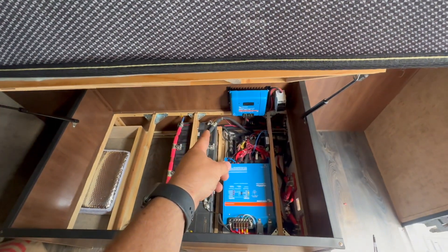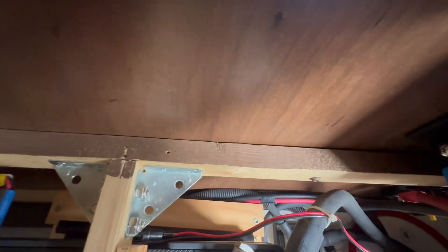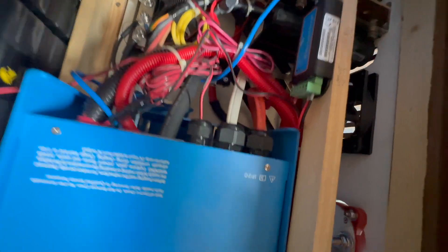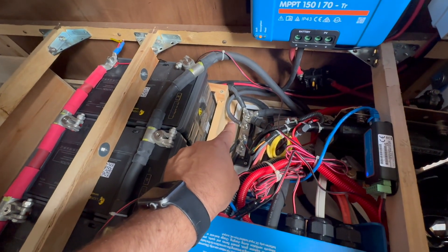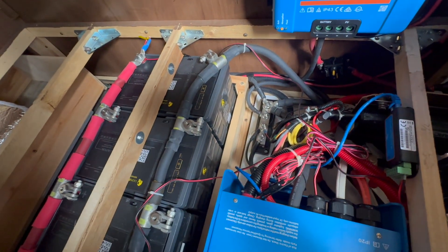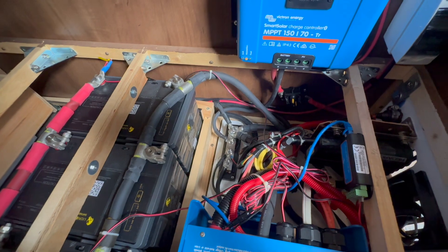The previous owner had actually run some wiring back behind here into a hole that made it out into the front tongue area. There's also a hole down here — yes, that's where everything was run. We ended up going through there; it wasn't too bad. What we ended up doing was taking the negative from the alternator charging system that the previous owner had hooked up, and we pulled that wire through with the solar wire attached to it, pulled some extra through, and then pulled the alternator cable right back through. We used the existing cable as a pull wire or pull string — that worked out really well; that was JD's idea.